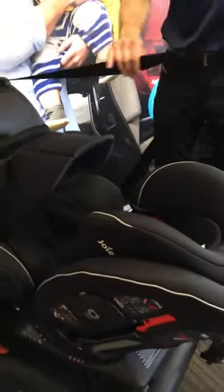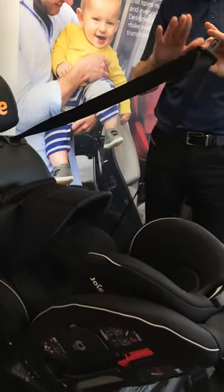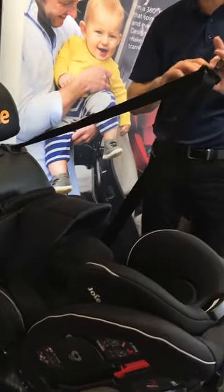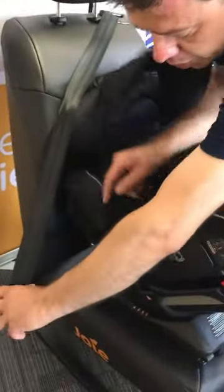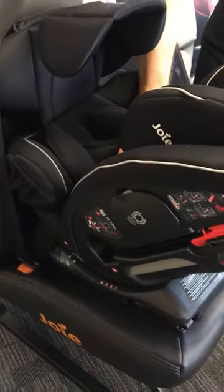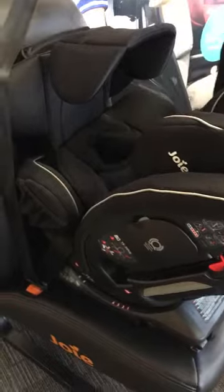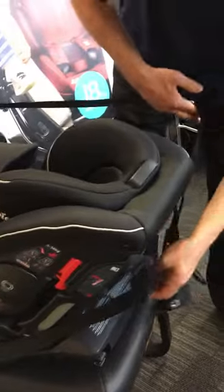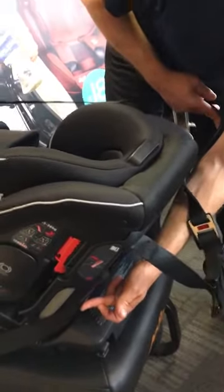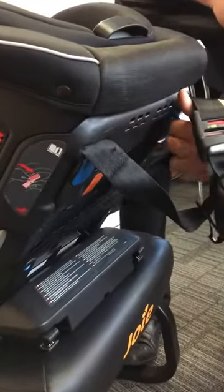The best routine when fitting is to pull the tong section up to the roof of the vehicle. Lifting it there ensures the lap belt isn't twisted at all and gives sufficient length to feed the belt over and through the guides, clipping straight into the buckle to keep it straight through the path. Then pull the diagonal seatbelt out and around, going round the back of the seat, underneath the top tether section, through the lower belt guide and back up through the upper belt guide.